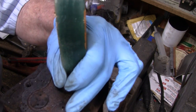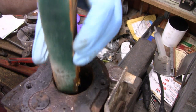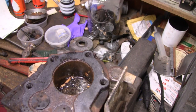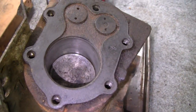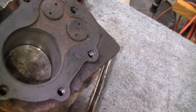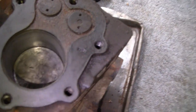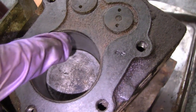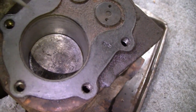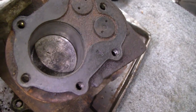We did get quite a bit of movement out of it. I'm probably bottoming out against the connecting rod now. So what I'll do is I'll polish that all up in there, and then we'll go at it from the back side. I got that piston down as far as it'll go — it's up against the crankshaft. I polished the inside with some fine emery paper — it didn't take any metal off, it just took the crud off. The cylinder walls on this are actually beautiful — there's really no scarring, no pitting or anything like that. I think we'll be fine. We'll turn it over and try to knock it out from the bottom. I'll spray this with some silicone oil, which will lubricate it, and once it starts moving it should come right out.